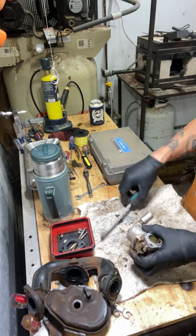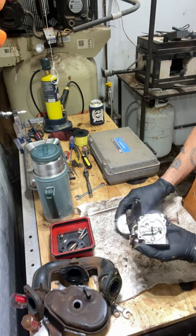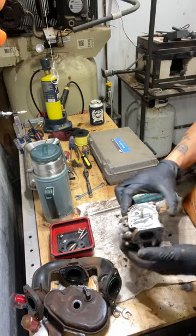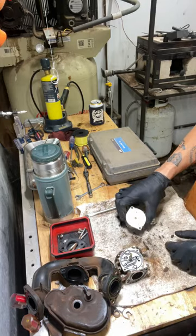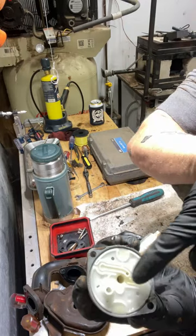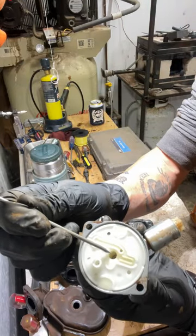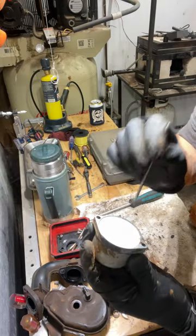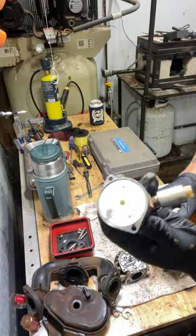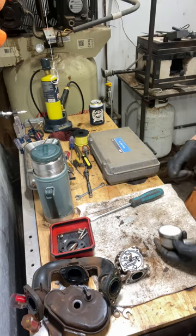There are two Phillips or flat head screws to take the bowl out. You can knock that loose because they have these little tiny O-rings on this model — that whole gasket is just a small piece. If you pull it off, be super careful. Inside this hole right there is a brass piece that you probably can't see on camera, but it will fall right out of there, and then it's really hard to tell which way it goes back in.